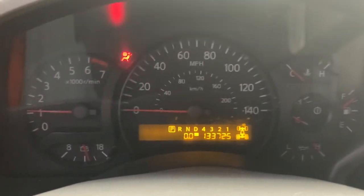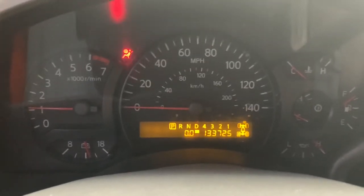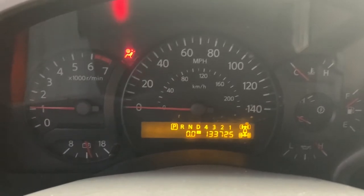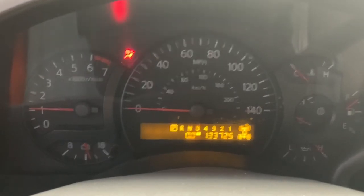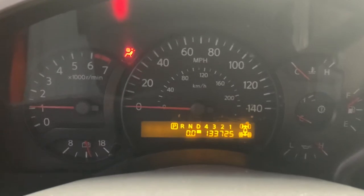Welcome back. So here we are once again. I've had this issue before — this is the second time. That airbag warning light will keep blinking until the end of time unless you reset it. Generally that comes from interrupting the electrical signals to the airbag system one way or another.